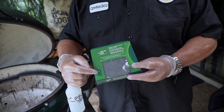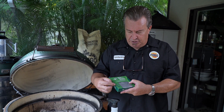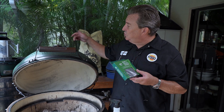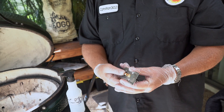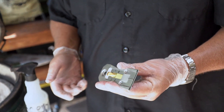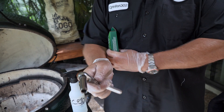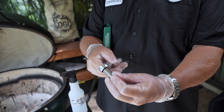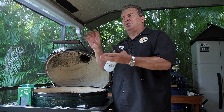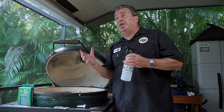They make it for all different sizes. This one's for a large, XL, or 2XL. It gives you enough to go around the bottom, the top, and usually enough to go around the chimney as well. You'll need your gasket material, any kind of scraper — I use a razor blade scraper, I find it works great, you can use a paint scraper, whatever you have. A 7/16 wrench or socket — I prefer a socket, just a little more efficient. And some acetone in a spray bottle, to get all that old glue off.